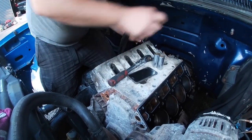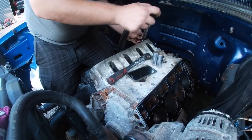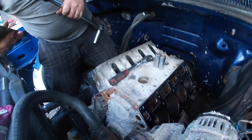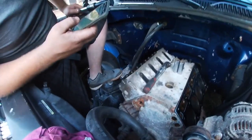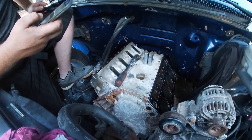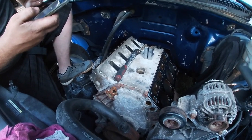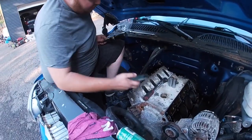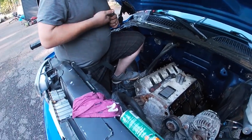Is it still 25 pounds for the 10 mils too? Yeah. I'd be surprised if those ever lift because it's got a lot of bolts in it. Well, the 10 mils are mostly just for the coolant passages and the oil gallery. And I got, yeah, some of the head bolts first pass. Some of the head bolts, M8 inner bolts, 22 pounds. Yeah, those I only do to 22 pounds, but I don't do the 90 and the 70 on them. Once they're on, they're on.